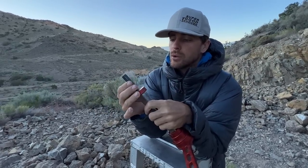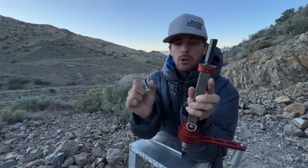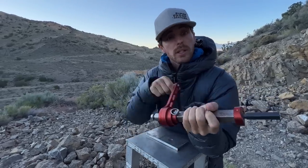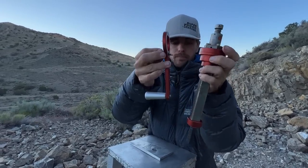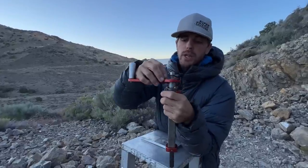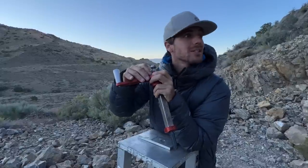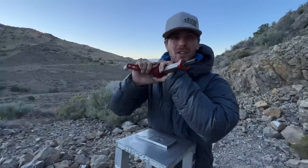You definitely want to score the bolt first — you don't want to snap it and leave it in the hole. This is a great tool for removing bolts. It's a little bit arched, which helps if you have uneven rock. There's a little clip so you don't drop your tool when working in the vertical world, and it unscrews so it packs down really well. The Bolting Bible has guides on how to remove bolts and more tools you could use. We were out here at this mine testing a whole bunch of bolts — thanks for watching.